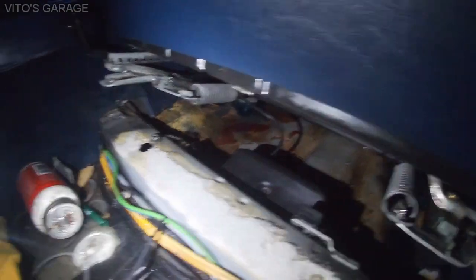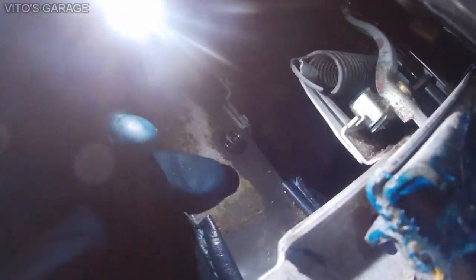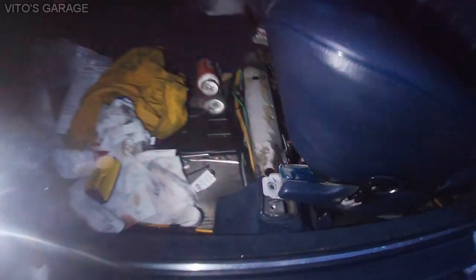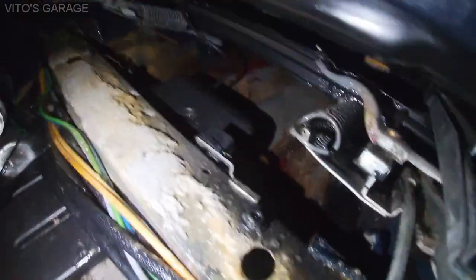It's pretty good. And right now I'm also gonna fluid film this cross member. I'm gonna spray fluid film inside from different angles. Really good stuff. All right guys, everything is nicely fluid filmed. The cross member, also inside the cross member, was fluid filmed.